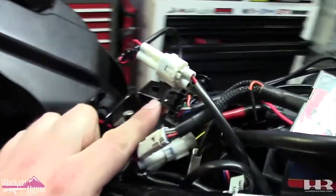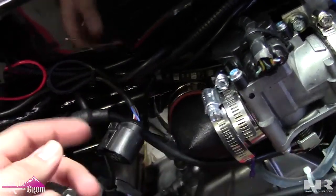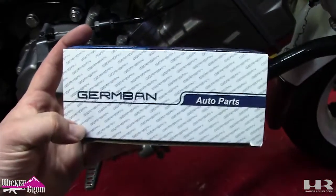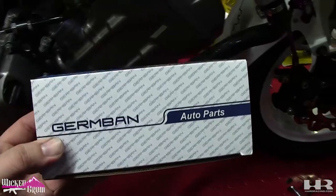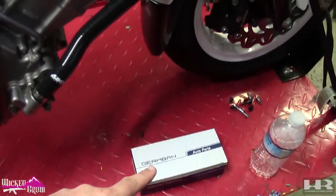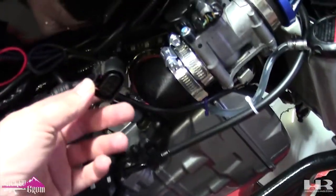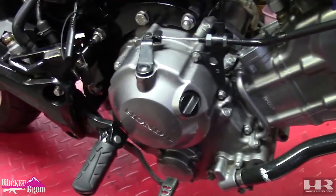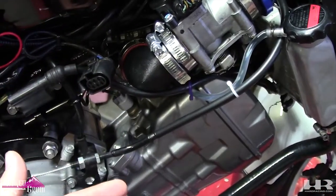This wire right here that goes from the AF1 comes down to the sensor. This is where your wideband will plug in. It's fairly common that the sensors that come with the AF1 go bad. I'll have a link for this in the description. This is for a Volkswagen and it's off Amazon. It's like 40 bucks. I've had nothing but good luck with those. I highly recommend having one on hand, so if your sensor goes bad, you don't have to wait. So this is where I run my wideband sensor plug. Later in a few minutes we'll be installing my exhaust that finally came, and this is where our wideband will plug into. So always have this wired, usually on the right side of your bike, makes it easy.